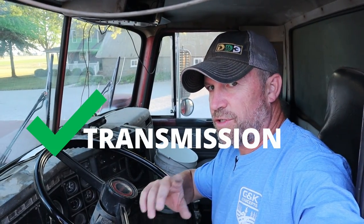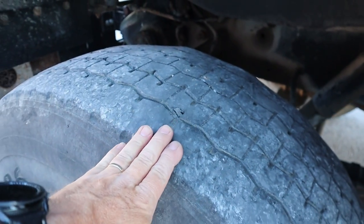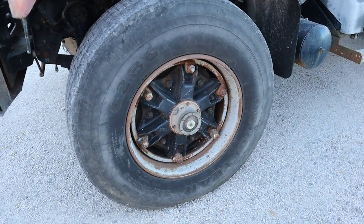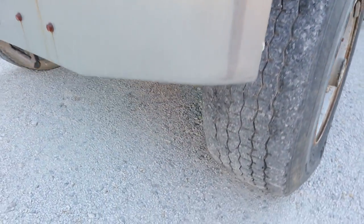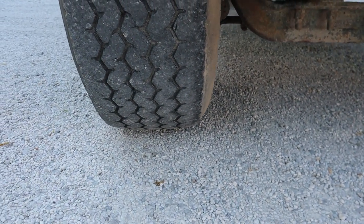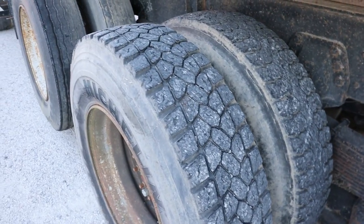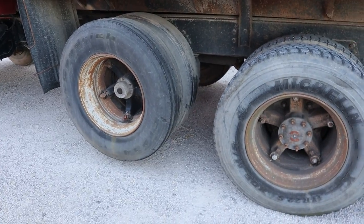I had trouble shifting it on the way over here, and I was also trying to film and fly a drone while I drove it. One of the things that's going to need, if I do put it on the road — which I'm not — is tires. This one's cupped really bad on the inside. It's got these big floaters on the front — they're 385/65/22.5s. This is a super single here. That could be a result of the kingpins being bad — I'm not sure. I'm going to probably have to have somebody check out the kingpins. Tires are all mismatched — it's one of those deals where you got one tire go bad and you replace it and keep going like that. There are a few flat ones. I don't know if that air tag axle works or not — that's one thing we've got to check out.